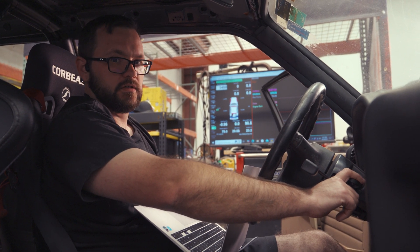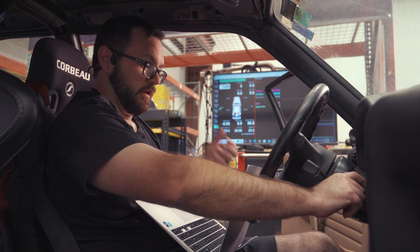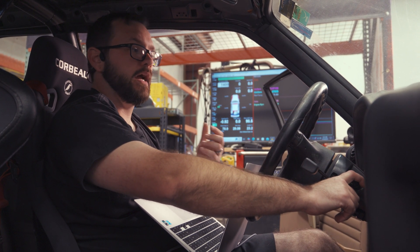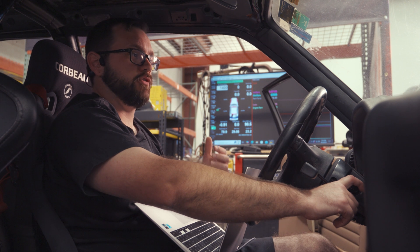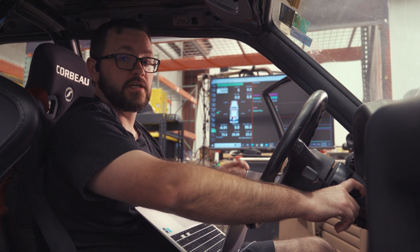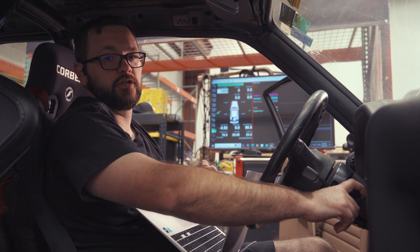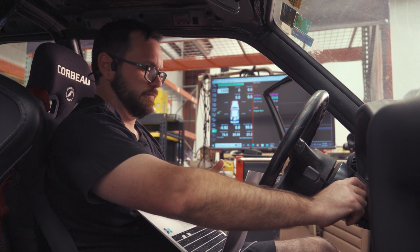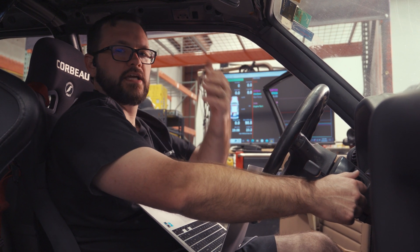We can't shut it down and do an immediate restart — we need to let the fuel vaporize off the hot intake manifold. I highly suggest doing this with the engine fully hot, meaning it's been running for an extended period of time. If you have a hard time after an extended restart where the car has been sitting, you may actually need to increase your priming pulse instead. For example, a Miata will sometimes boil the fuel in the fuel rail when it's shut off after a hard track event with the hood closed. Non-return style fuel systems generally have that problem; return style systems don't, unless the return is at the back of the vehicle.